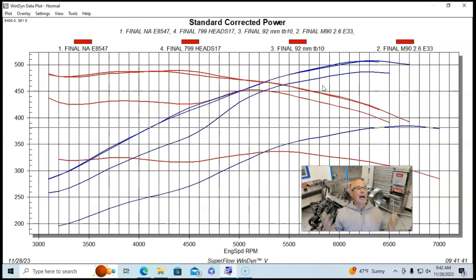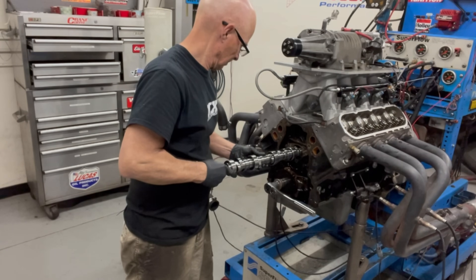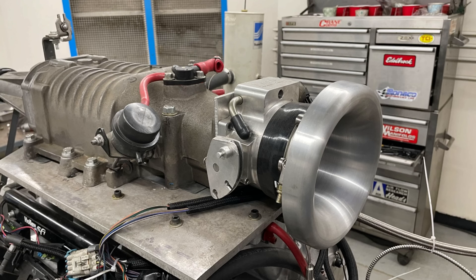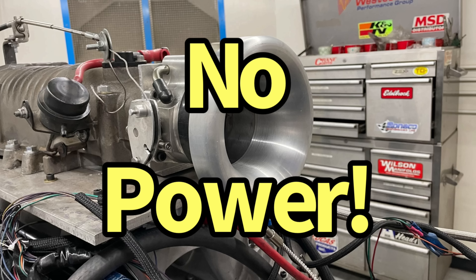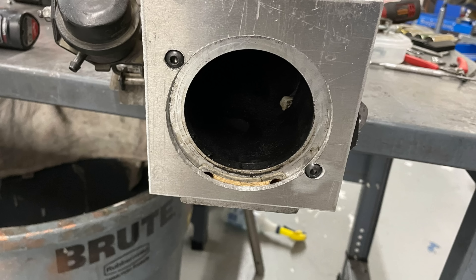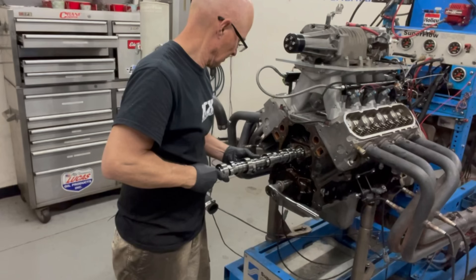Now let's find out what happens when we add the camshaft. The last three tests include the camshaft upgrade, the header upgrade, and the radius air intake. We put a bell-mouth entry on the throttle body, but it made no power. Bell-mouth entries do work and do improve flow through the throttle body, but the throttle body was already bigger and flowed more air than the entry going into the blower. So the radius air entry looks cool, but in this case it wasn't worth any power because that was not the restriction.